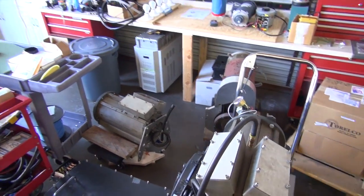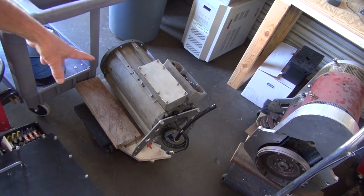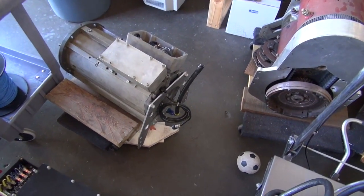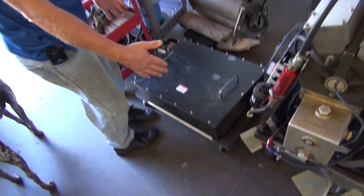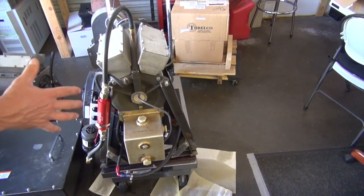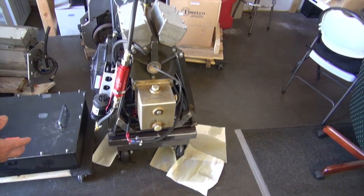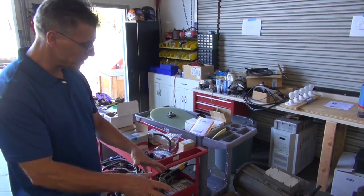When we went to EV 1.1, we used this motor made by Northrop Grumman — an AC motor that was liquid-cooled. You can see the two boxes on the top of it. After about six months of investigation and programming with our controller, we realized it really did need its original giant computer controller; it takes a bridged controller — meaning two controllers — to operate it. So we scrapped this system and built a bench motor that our programmer could use. It's fully operational with a cooling system for both the controller and the motor itself, and it's self-contained.